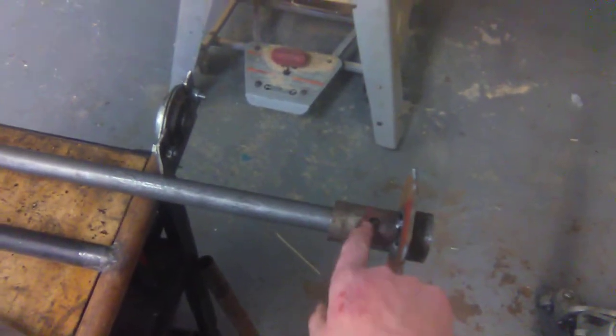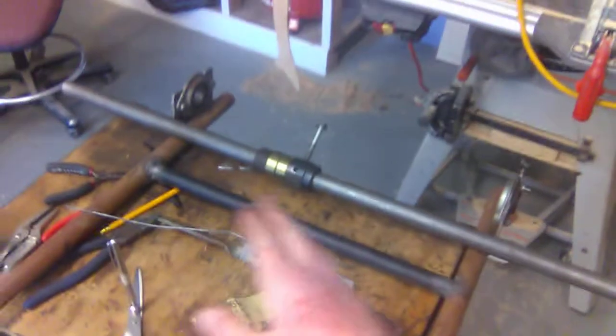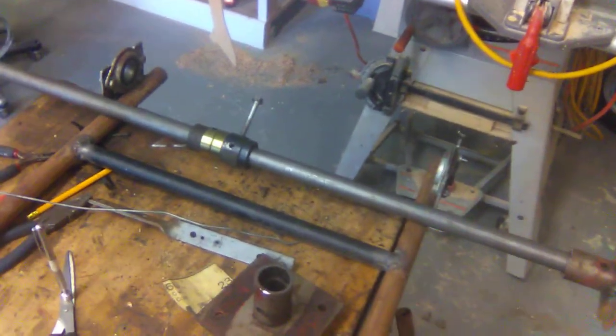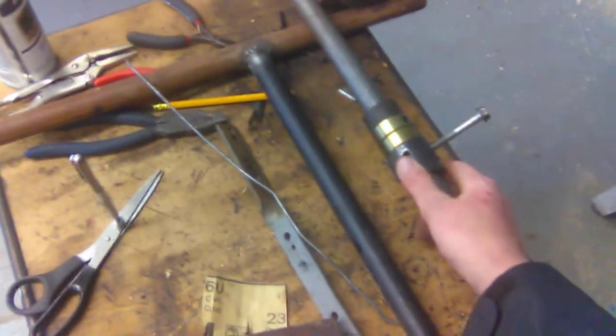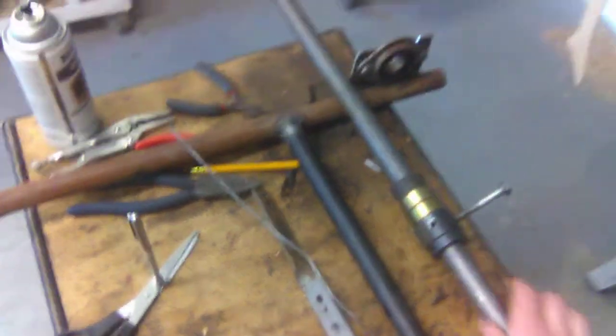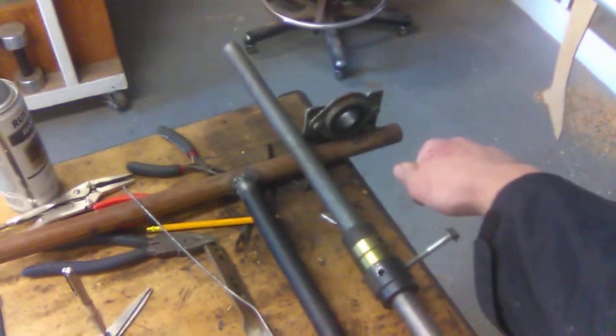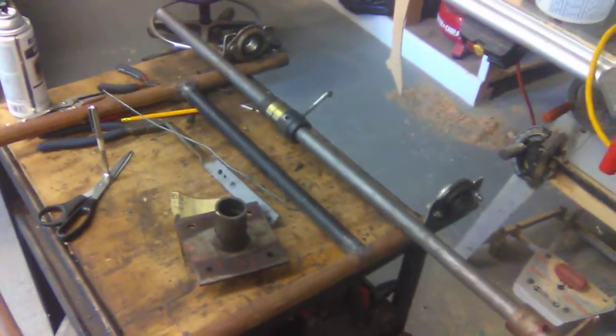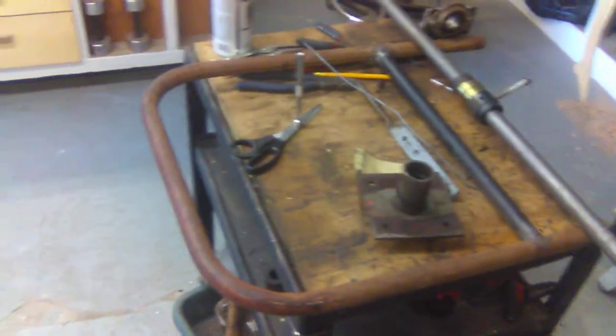Mount it on the axle and just drill through and bolt it to the axle, because this is obviously not keyed. This is what we have. The sprocket will probably be welded, or maybe we'll do the same thing, drill a hole through the axle. I don't know. This is 1-inch shaft, it shouldn't break. And we are probably going to have one more carrier bearing here, so the sprocket will be fine. So yeah, that's about it.